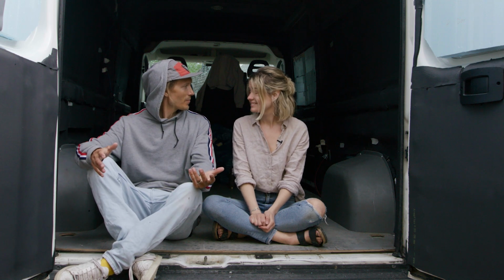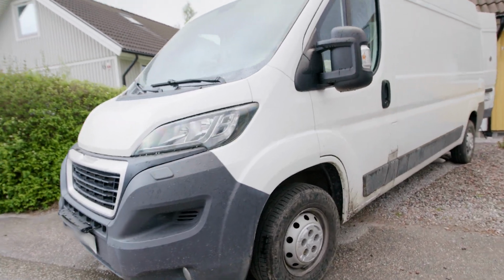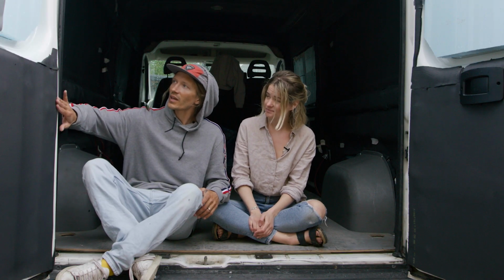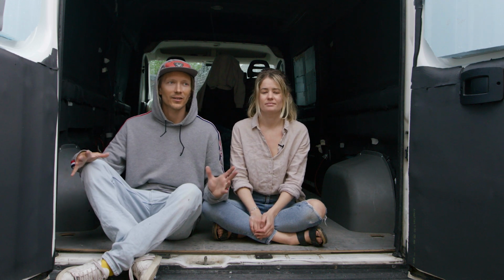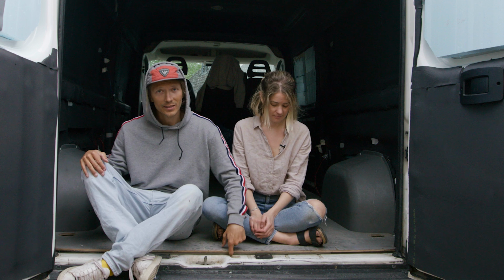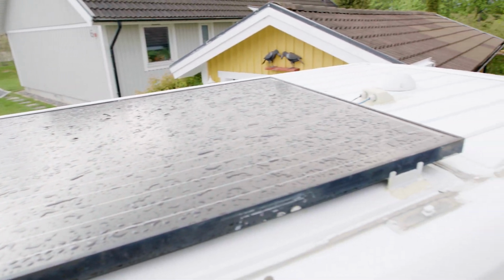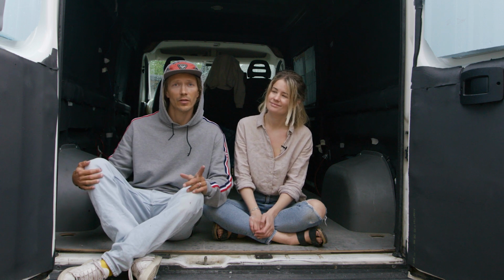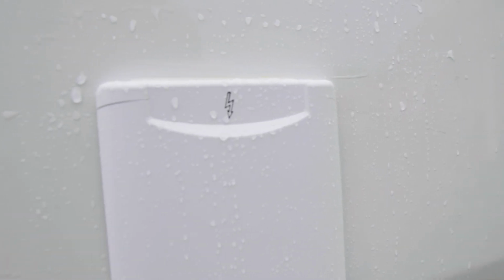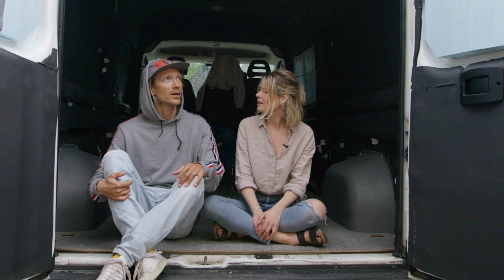All right, week 1 wrap up. So how's it feel to be finally underway with this project? So nice. So damn nice. So, what have we done? We've gotten off to a great start, I think. We've done all that kind of groundwork you have to get finished before you actually start building your van. We've insulated the floor, the walls, the ceiling, made sure everything's nice and covered in insulation material, Armaflex, XPS, sleeping mats, everything nice and soft and warm. Ventilation is in? Yes, we put in the roof vents from Dometic, and our little air intake here from VanBob, thank you. And shore power intake. We prepared a little bit for electricity. Mounted the solar panel, and done quite a lot.